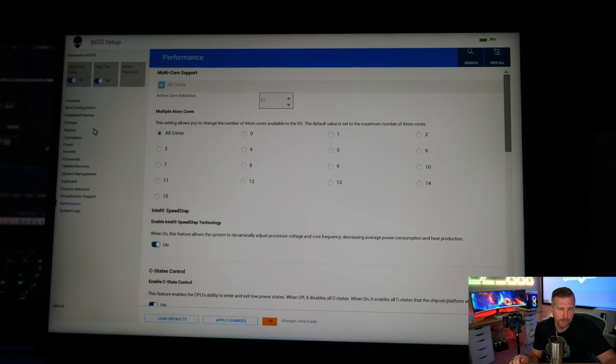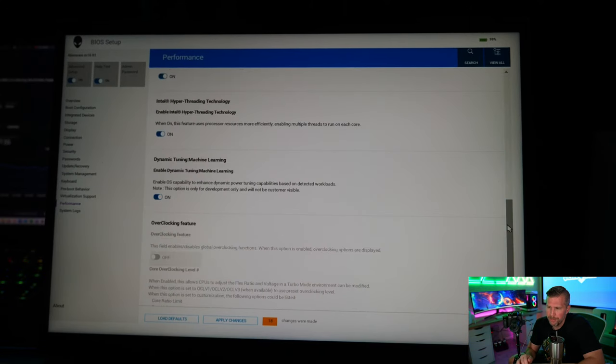Got here late. Did we see any improvements in temps over 2022? Can't mentally handle all the time at 100 degrees in 2022, especially X series. So he has the camera. You're going to be able to set your temperature targets based on your power limits using Intel XTU manually. By default, this thing runs crazy cool because the power limits are very low.